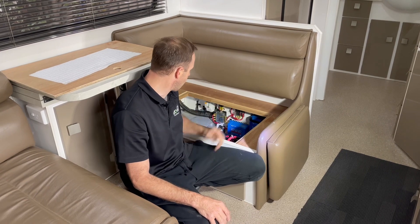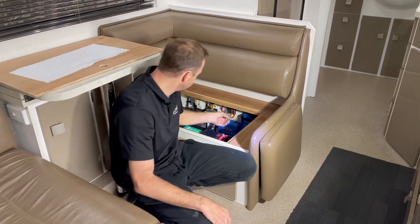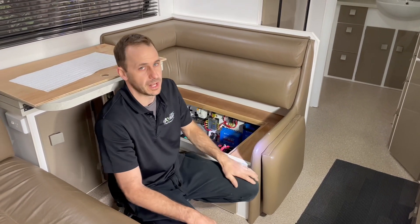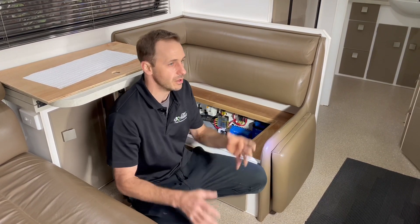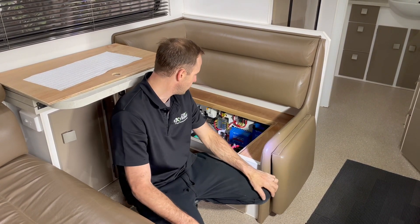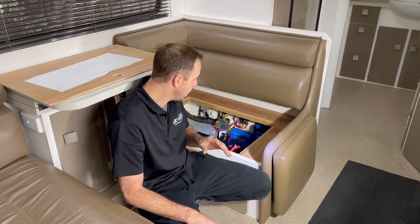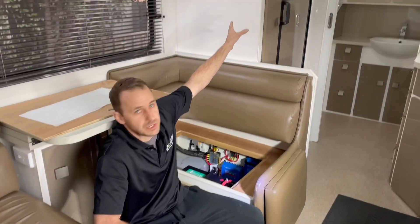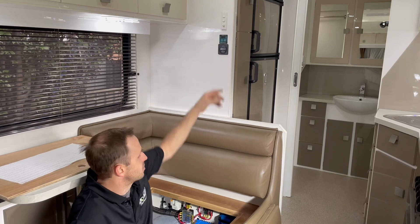We've really gone through every join and redone it all better. We've got MIDI fuses now, main circuit breakers all rewired, fuses changed. We've got a compressor fridge in this thing which was wired horribly — that's all fixed now and this thing's ready to go. I'm going to show you guys how simple this is to work. As complicated as it can look, with the displays showing your battery monitoring, it'll turn your inverter on and off all at the flick of a switch.